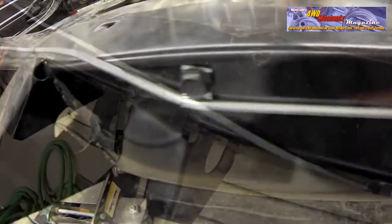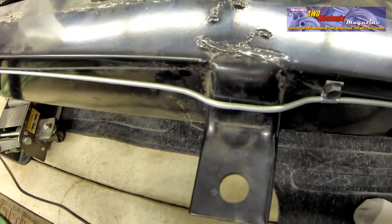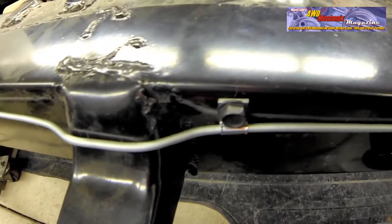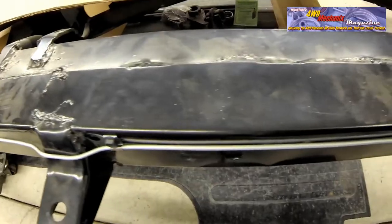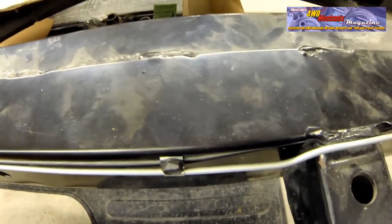Always make certain that the tubing is not moving over a rough edge. This is a rare convertible chassis that has an X member through the center of the frame. The clips are attached to the original holes drilled by Chrysler in 1957. Tubing follows the original routing.